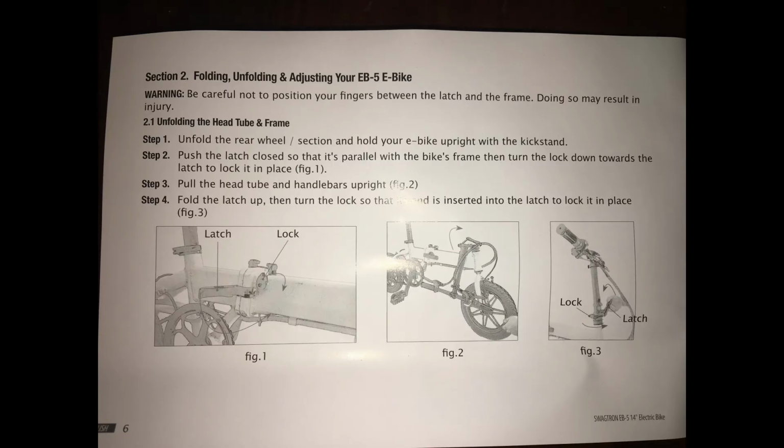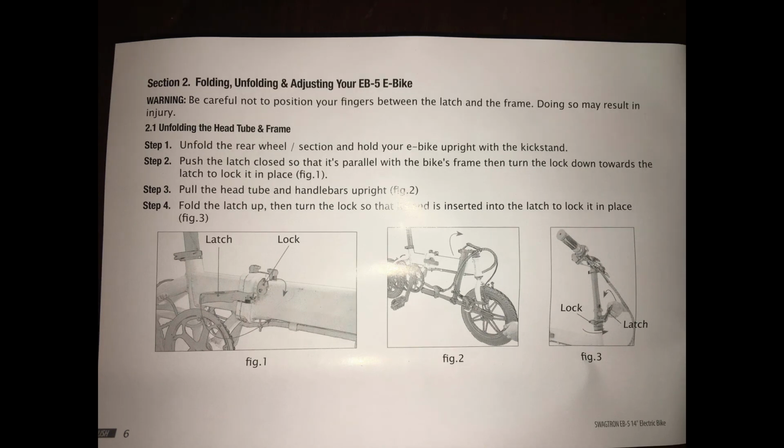Wipe the outer body of your e-bike with a soft, dry microfiber cloth. Check around the wheels and ensure there is no blockage. The e-bike meets IPX4 water resistance, meaning it can withstand splashes. However, do not submerge the e-bike in water. Do not let water and liquids get into the e-bike's electric parts or battery.